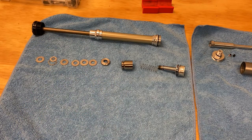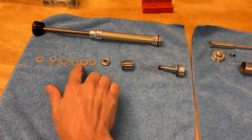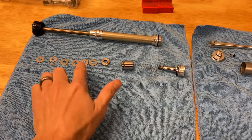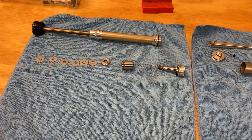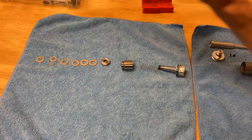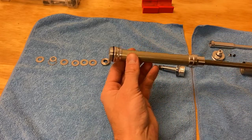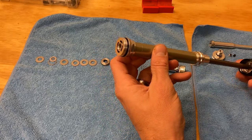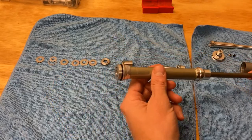Really consider the trails you're on. If you're on something with a lot of tiny chop, roots, and baby-head rocks you might want this softer. If you're doing nothing other than standing up on really smooth blue-groove singletrack, maybe you want this harder. A lighter person is obviously going to want a lighter shim stack too. So if you weigh 100 pounds and you're complaining about your damper cartridge being too harsh over small chop or square-edge hits, this is where you want to start tuning.